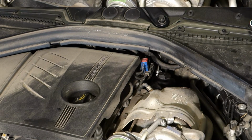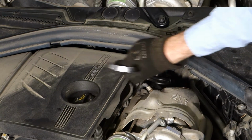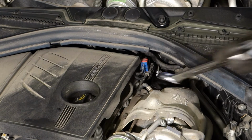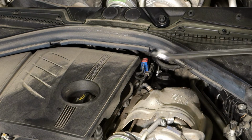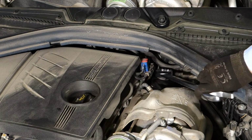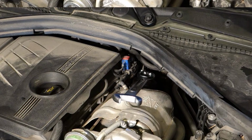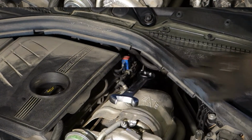Okay, and then for this final tightening, I take this 33 millimeter thing and then the wrench. Then I fasten this cover, and remember, I must be very careful, because this part is plastic, and I can fasten that only a little bit, not too much, because otherwise I damage this cover. And be careful. Do not fasten and tighten too much. And soon we go. Okay, and now when I am ready, this is now quite tight. I don't use too much force, but enough, and now it is okay.